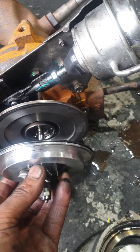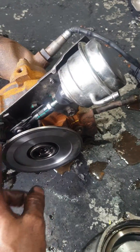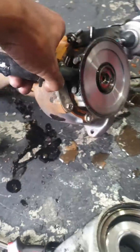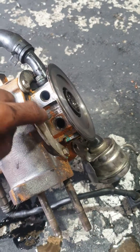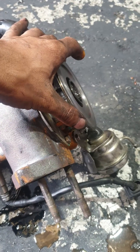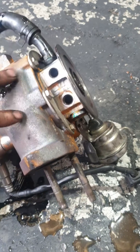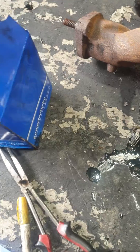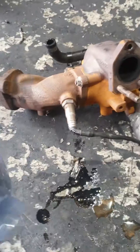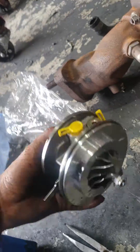It was leaking oil — the oil was going to the engine. So we removed ten bolts around here, and now we remove these ten bolts around here. This is the cartridge that actually got destroyed and needs to be replaced. No need to replace the body or anything else. This is the new kit — it's the washer and the cartridge.